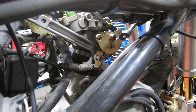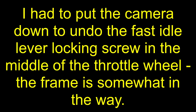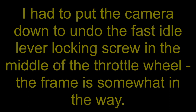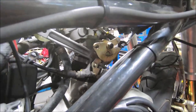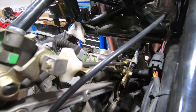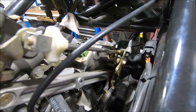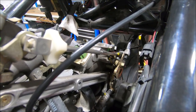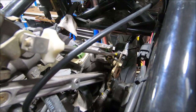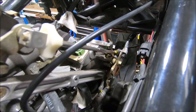What you need to do is back off the little lever that this lever runs on. This screw is now loose — just here. And if we look from the top, you can see the top of that intermediate lever moving there. So having undone that, the fast idle system isn't going to be a problem when we get into adjusting the TPS, because we need the throttles fully closed. Quite often the fast idle stops that from happening.